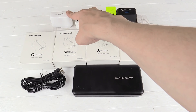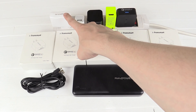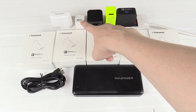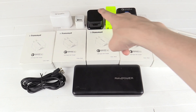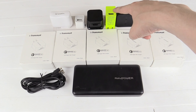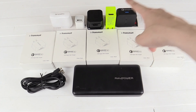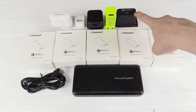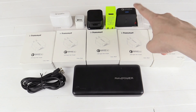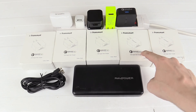So what do we have here? The first charger is from a super cheap cell phone and it only charges at half an amp. Then I have an iPhone charger which charges at 1 amp, an Amazon charger which I believe is 1.8 amp, a UE Boom charger which I think is around 2 amp or maybe a little bit higher, and then this new Tronsmart charger which I've actually managed to get 23 watts out of at varying voltages because it's Qualcomm Quick Charge 3.0.